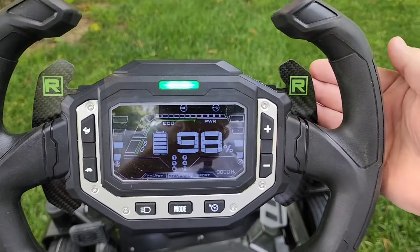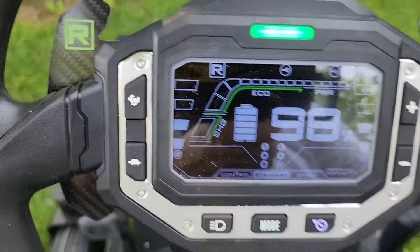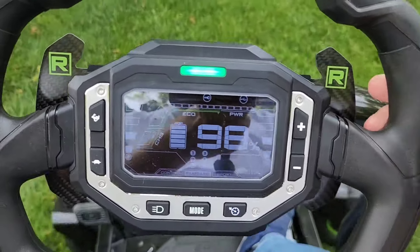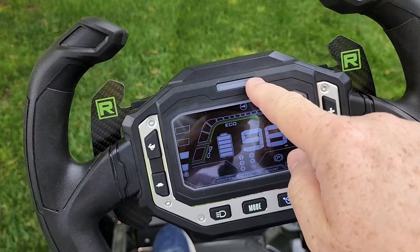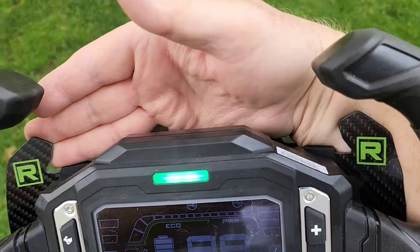To go reverse, press one of the paddles and hold it — you'll see the big R on the display. Then press the gas pedal and you go in reverse, and you can still steer. When you let up, you go forward again. If you park on a really steep hill, this thing will move on you. So set the parking brake, that light goes out, and then just step on the parking brake to release it and do the paddle wheels again.